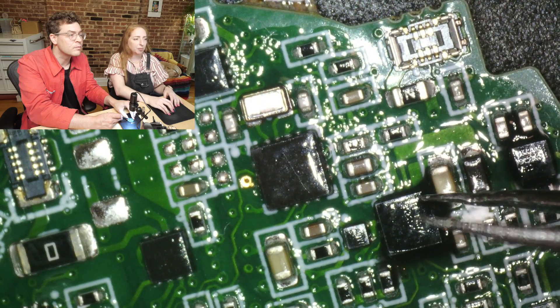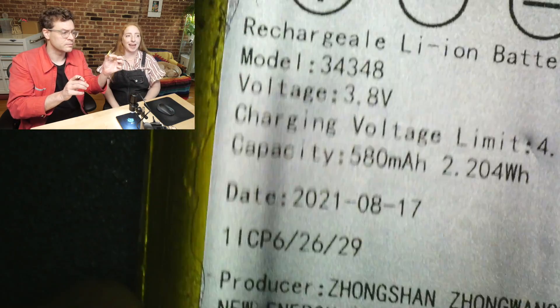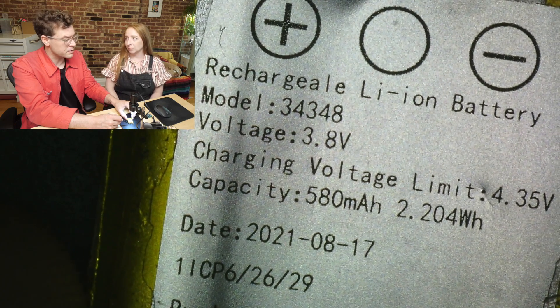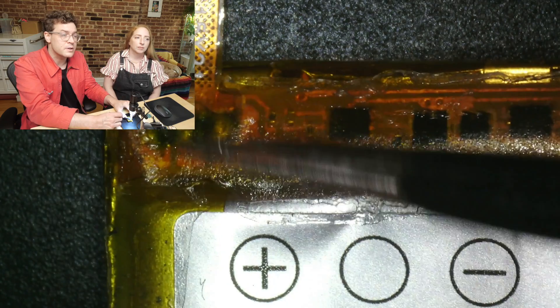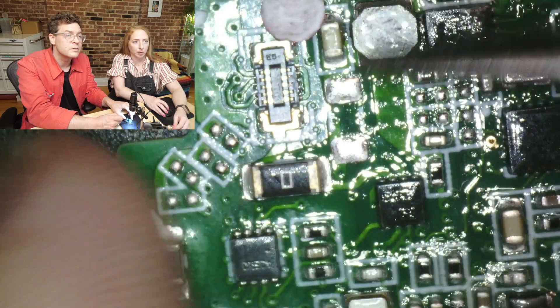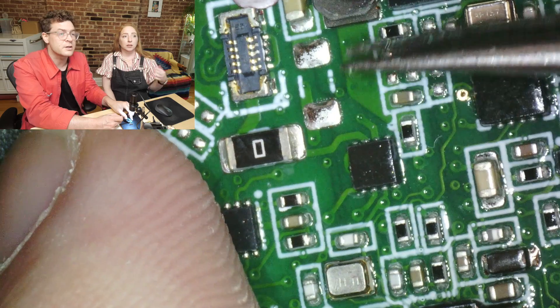The only other thing I was able to find online was the brand for the battery — Zhangshan Zhangwande New Energy Technology Co. — and the battery is a 580 milliamp-hour battery. Why does this device need such a big battery? Because Peltier coolers are pretty inefficient, so it probably needs a lot of juice to keep it running for the amount of time they want. We also see the other part of that connector that snaps on, and there's protection circuitry for overvolt and short protection wrapped up inside, providing an extra layer of safety. That connector on the left is for the Peltier — it's got huge beefy traces because it needs a lot of current.